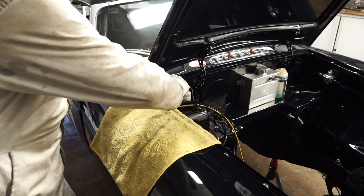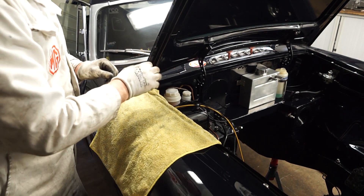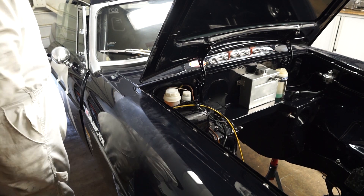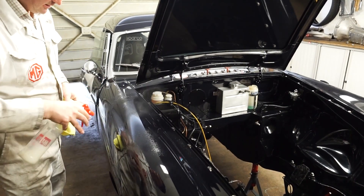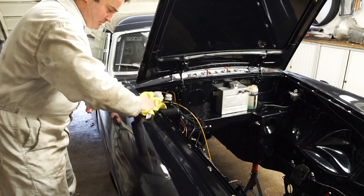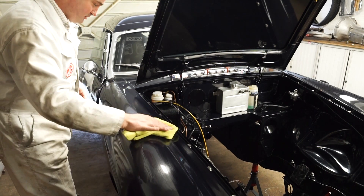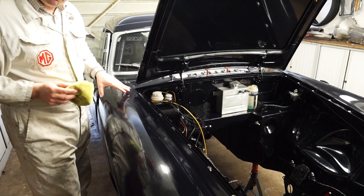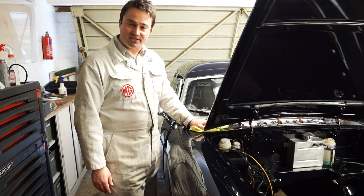Now that I'm happy with the fluid level I'll put the cap back on — this just needs to be finger tight, because the fluid expands and contracts and if it's too tight it may suck the cap on and make it hard to undo. The final thing I'll do is take a little bit of cleaner and wipe down the wing to make sure there's no contamination. This is just a detailing spray — I'll give that a gentle spray over. It's always a good precaution to make sure you haven't got any fluid that's going to damage the paint. You can also use water or soapy water in a sprayer to make sure you've got no fluid left around the master cylinder or on the paint. That concludes our video for today — I hope you've enjoyed it. As always, with any questions don't hesitate to get in touch, and don't forget to like and subscribe. Many thanks, bye.